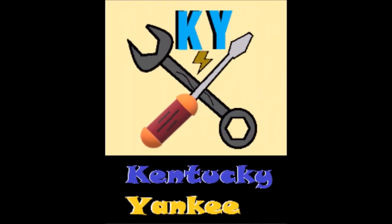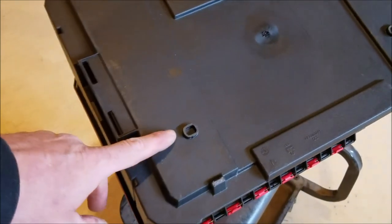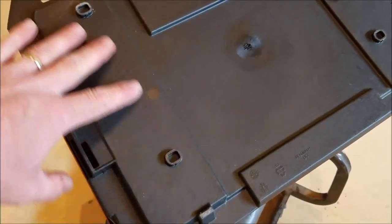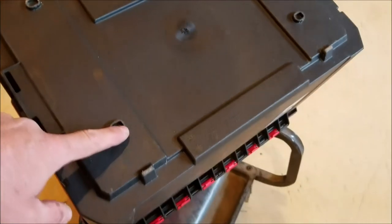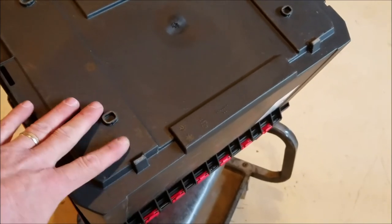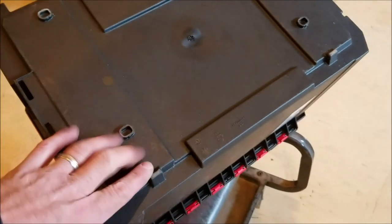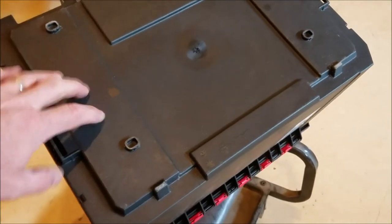So you can't get it out, but you'll be able to slide this out — this is your toolbox, this frame stays on the rack. It just so happens the best place to mount the brackets or V braces is right here where these little things are. I can't cut this off because it goes in the box, but that's okay — I'm gonna cut these two off with a grinder and then the end will butt up against this, and I will screw them on to that channel.